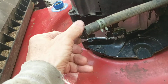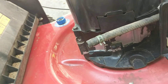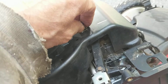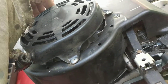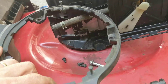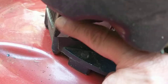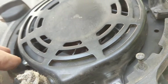The tank is going to go on with this nut here, which I'll take off, and also get screwed in at the top with three screws — here, here, here, and another one on the far side. I reattached the gas hose from the gas tank using a 3/8-inch bolt for that, and 8-millimeter on the tank screws. They might not be the exact sizes but they seem to work.